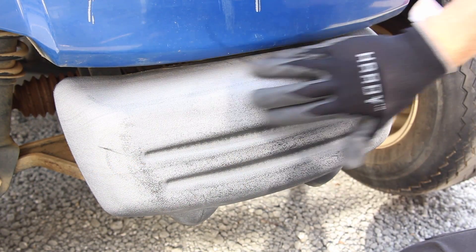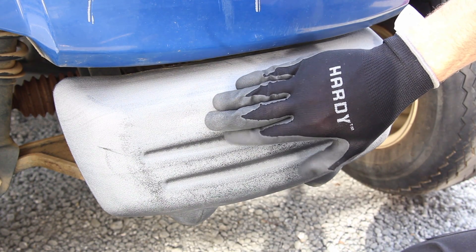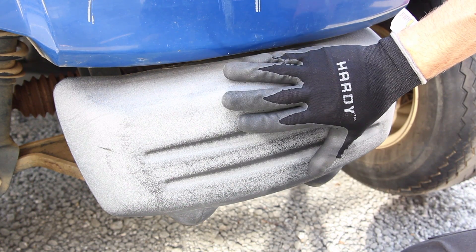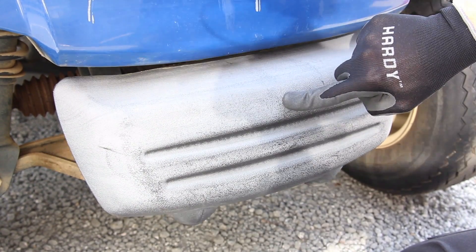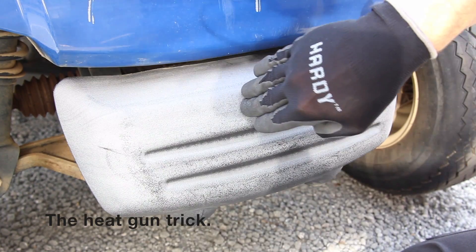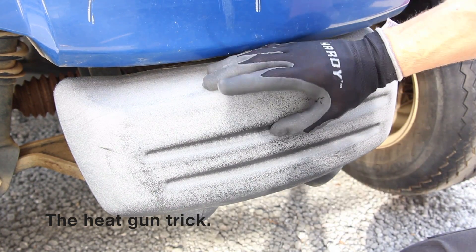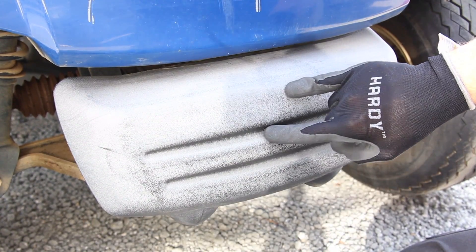Once your plastics have this level of fading and oxidation, the carbon black has been exhausted from the UV exposure, which is exactly why it turns grey. Carbon black in your tires and your trim work — they're black because carbon black is a competitive UV absorber. The UV rays hit it and disperse as heat. So this is exhausted — there is literally no pigment to enhance with the Renew Protect products currently as is.